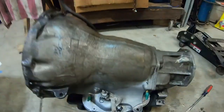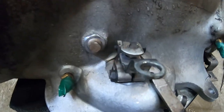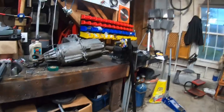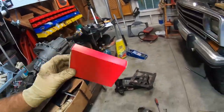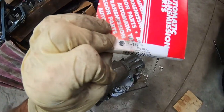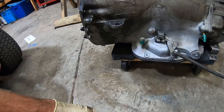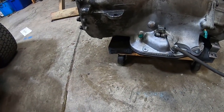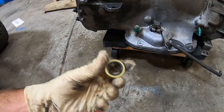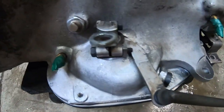Main culprit — this guy right here. Underneath that little shifter right there is a seal. On the new seal — big giant box — let's see if I have a part number: part number 14582. Big box for a small little seal. So that's going to sit in there, but first you've got to get the old one off.